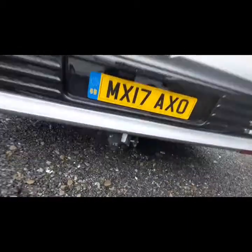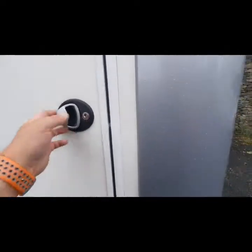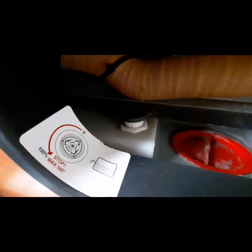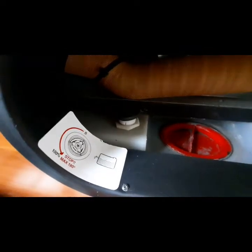The rear of the vehicle has a tow hitch added by the customer and a rear-view camera at the top. The door on this side is also double-action and gives you access into the drain point for your fresh water system, located in this area here — press the hatch down and it's clearly marked. The small black wheel at the top: turn it clockwise to fill, anti-clockwise to empty. Doing only that one will fill the tank to 20%; doing the one on the other side allows you to fill to 100% capacity. To empty both, wind them both anti-clockwise.